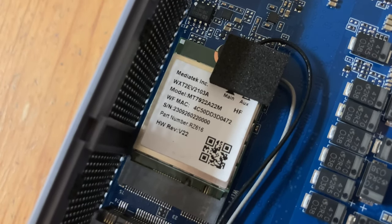We tried delivering power to it using the USB-C — the only thing we had was a 65W power brick by JSUX. We did have to lower the TDP in the BIOS, but using the quiet setting we got Windows loaded up and could play some Rocket League. If you are looking forward to using AMD AI, unfortunately it's not available on this mini PC — if that's important to you, you may need to look elsewhere.